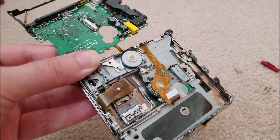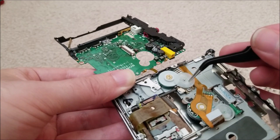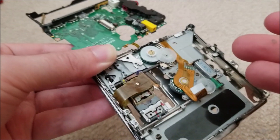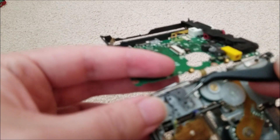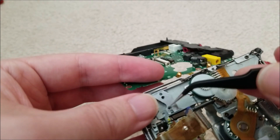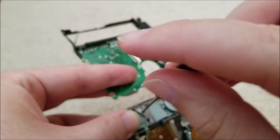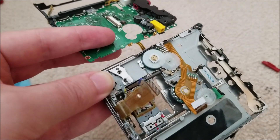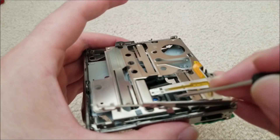Grab the gear we removed and gently put it on the axle, give it a few rotations to make sure it's seated correctly. Then there's the absolutely tiny blue thing — you can barely see it on my finger — that has to go on there, so I'm going to do that off camera so I don't lose it. Now it's a matter of realigning the overwrite head again. There's an alignment hole and then the two screws pop right on. The alignment isn't critical but it does have to be kind of directly over the laser, otherwise it won't write correctly. Looks like the overwrite head is aligned correctly — it's directly over the laser.